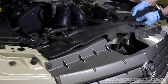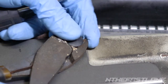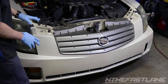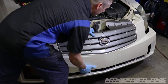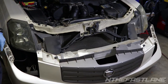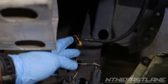Remove the dust cover by pulling up, then remove the five or six grommets underneath, same as the wheel wells. Now that everything's disconnected, slide the front bumper off and gently set it on the ground. You don't have to disconnect the fog lights, but if you want to polish them up while they're out you can disconnect the wires. To remove a fog light, lift up on the clip, pull out, disconnect the one cable, and the whole assembly slides right out.